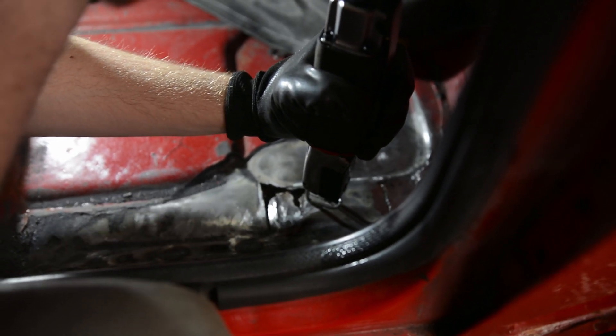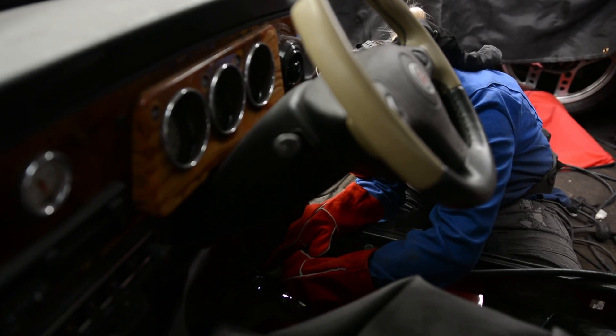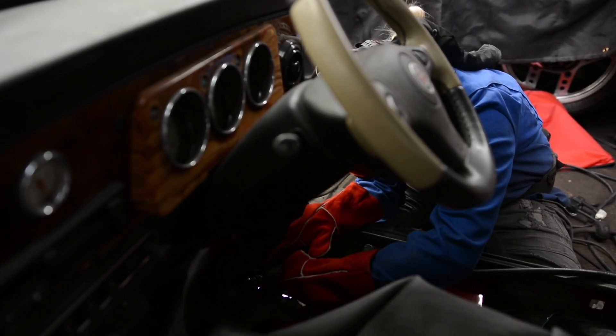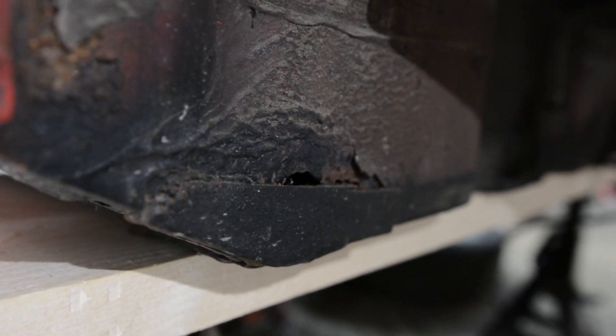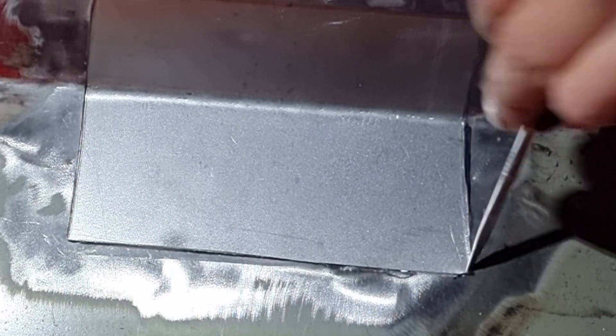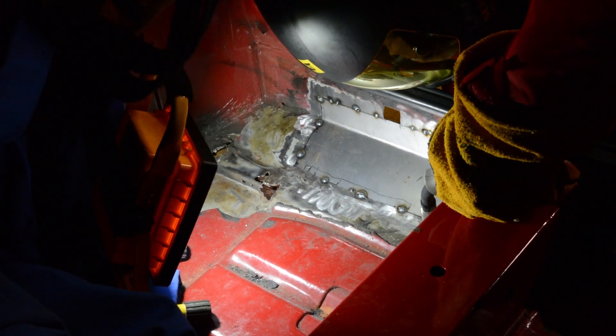Here I am again cutting more fresh metal, welding and grinding away any excess welds. The first step to repairing rust on any car is to ensure you have the correct gauge of metal — my Mini uses 0.8 millimeter thick metal. Overlapping metal in my opinion is not an option; butt welds are the way to go as it is the most effective way to prevent rust long term. It is crucial to spread out your tack welds and distribute the heat evenly by welding on opposite edges.